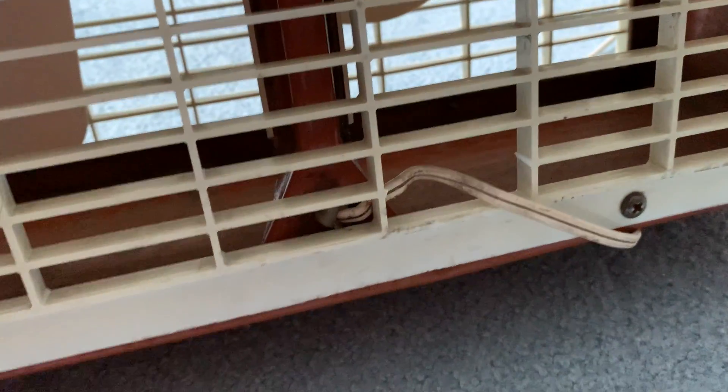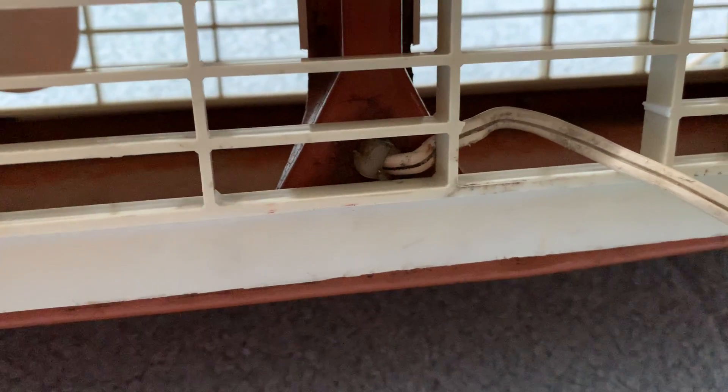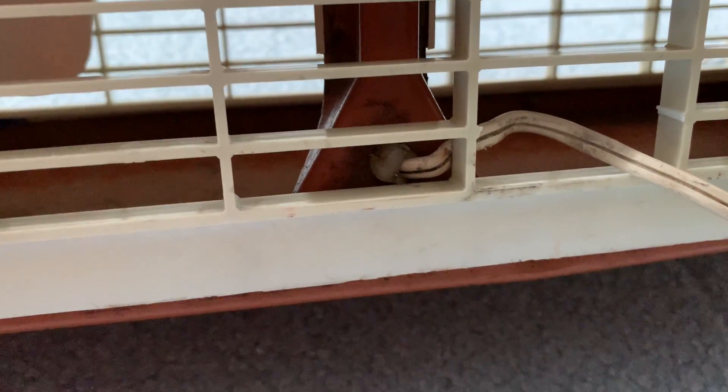The previous owner - I bought this from eBay - obviously did some work to this fan, because that's not the original plug and the cord is a lot shorter than it should be. There was no handle when I bought it, so he must have broke it, because there's a dent in the cabinet. He put tape around the bottom and the grommet was loose - it would just come out with the cord. When I looked closer I realized he put the grommet on backwards, so I put it on the right way and now the cord isn't going to fly out.